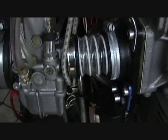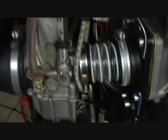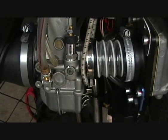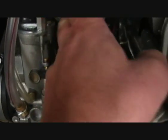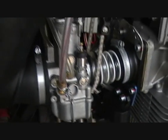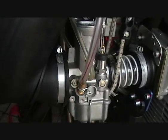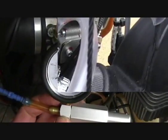After fitting the fuel pump the pressure was too high for the carb. To get round that, there are various ways of doing it but I decided to fit a pressure regulator. You need to check the pressure going to the carb — it's very simple to do. Just remove the fuel inlet feed and connect it to your little pop-off pressure gauge.